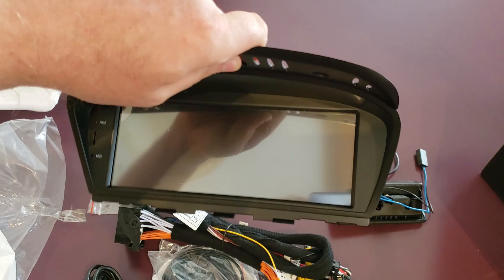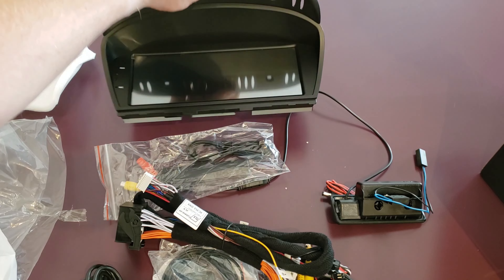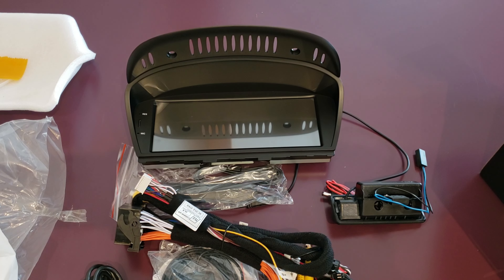In the next video I'll be going through installing this and we'll give it a try and see how it works. The idea is you can switch between the existing iDrive screen and the Android screen just by holding the menu button for three seconds — that was the main reason I jumped on this. To gain Bluetooth functionality and have any Android app available to download. I'm going to be looking at installing Torque on here, and I have a Bluetooth OBD dongle adapter that should connect to the screen too, so we'd have onboard troubleshooting and gauges. But also not losing the functionality of the iDrive — this will look completely stock until you hold the menu down, which was a big selling feature for me.